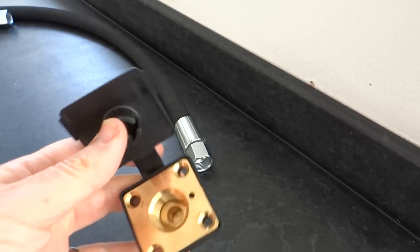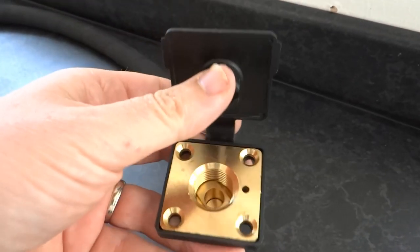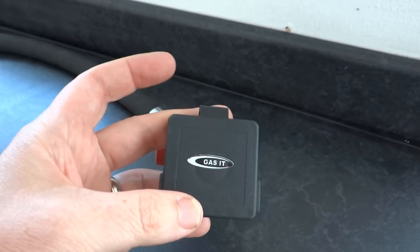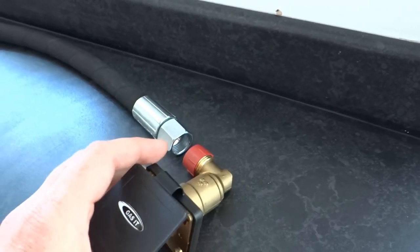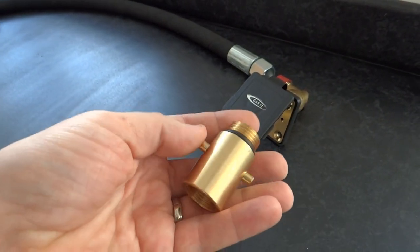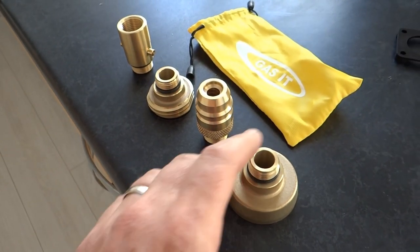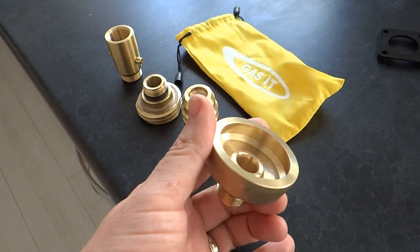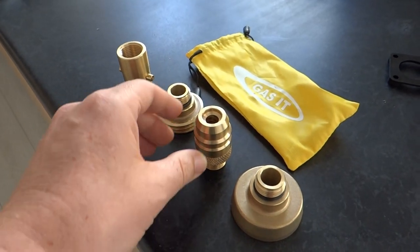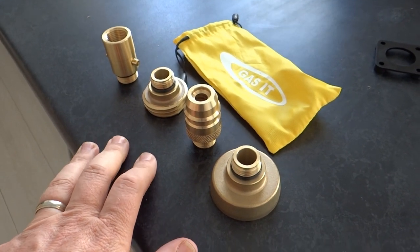So basically that will screw in to the end there — you can see it's got an angle on it which is deliberate. That bit will be fitted flush into the side of the van with a screw-in cap. It's a relatively small area it takes up on the side of the van. In that goes one of these — that's the UK one. You screw that in and then fit the LPG gun to it. There are different ones across Europe, and we've got a few different fittings from GASIT. We've never had a case where we've been to a fuel station and not been able to fill up.